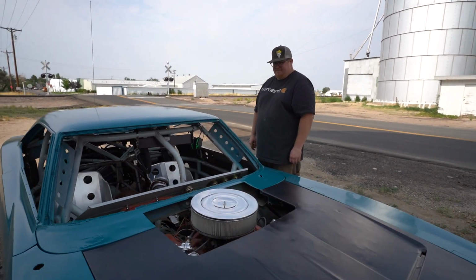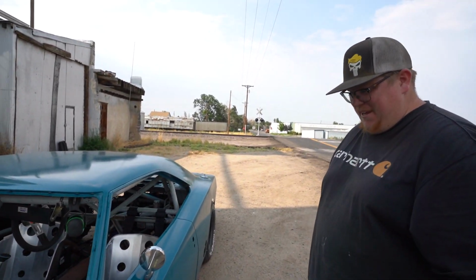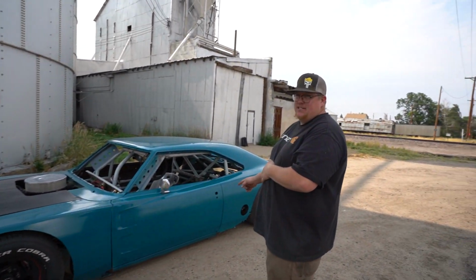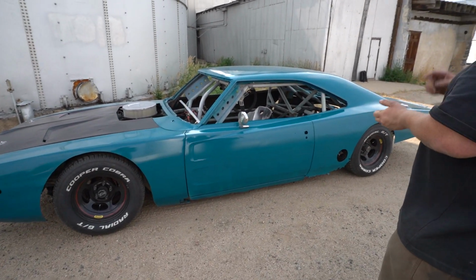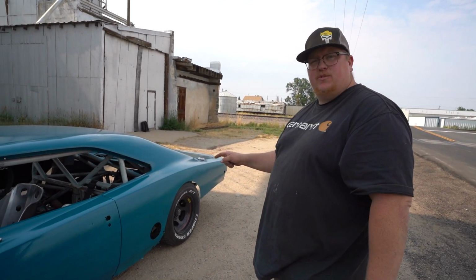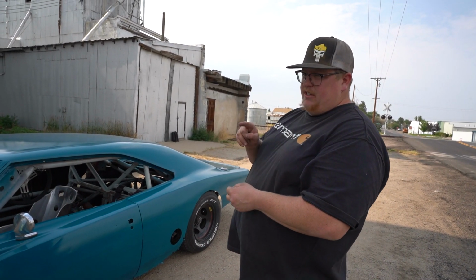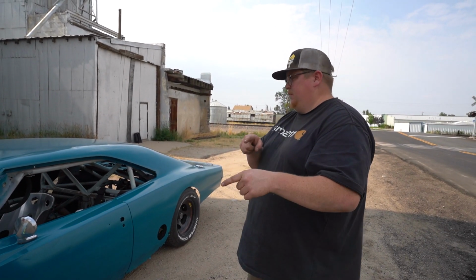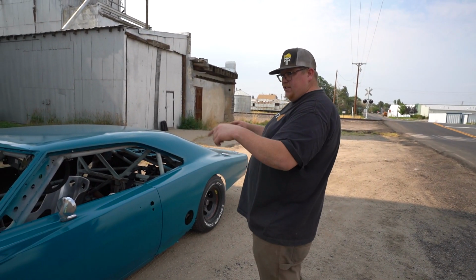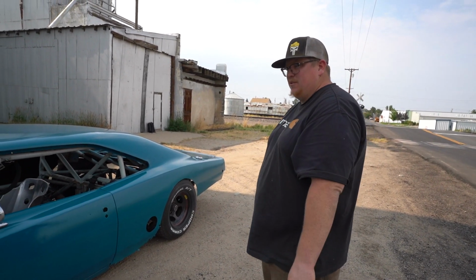And yeah, what else is there to talk about? It's ridiculous. It's about as low to the ground as you can make it. I think it's 3 inches off the ground, and I think actually part of the rusty body hangs lower than that. Yeah, 383 motor, 727 transmission. It's a Winters quick change rear end. So it's got the gears on the back, a pinion shaft that comes through and runs to the gears, so you can change those gears around. Pretty wicked setup. 3 link in the rear, coilovers on all 4 corners. It's a legit race car that's now street legal with a body.